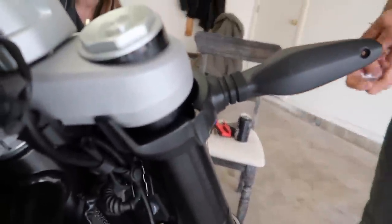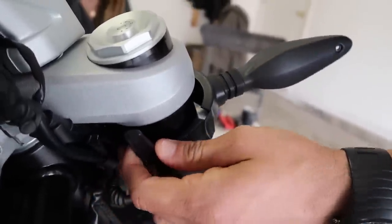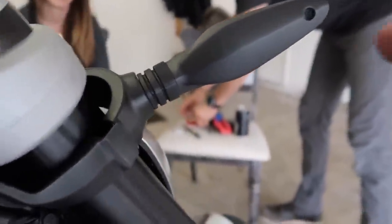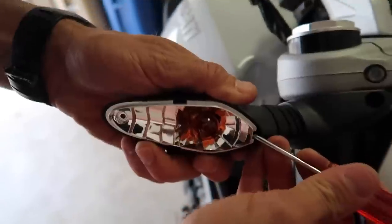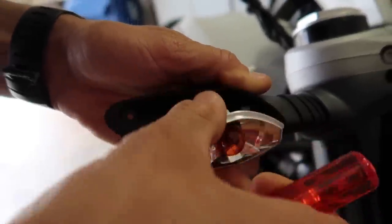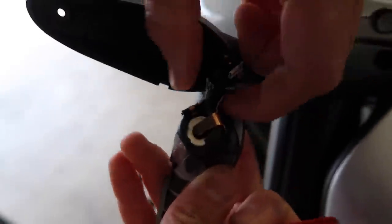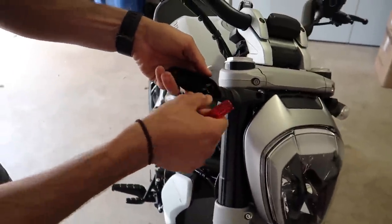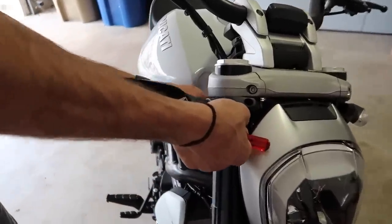Rupp's just removing these slowly. There's a little connector underneath here you've got to make sure you don't break off — well, actually you can break it off because this is a stock piece anyway. We've got to loosen this part, take this front off, which is what he's doing right now. Then there are some wires in there you've got to disconnect. Let's see what's behind door number one — there are the connections we were looking for. Simply unplug those bad boys, and then we can just pull those through and remove that whole plastic piece.